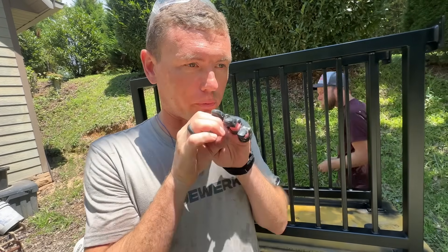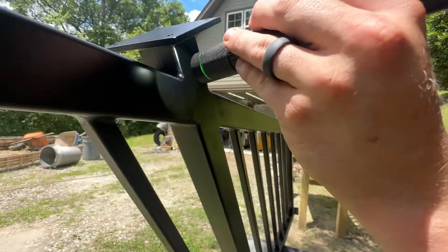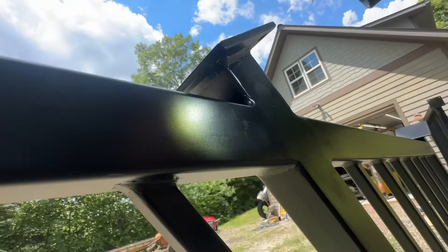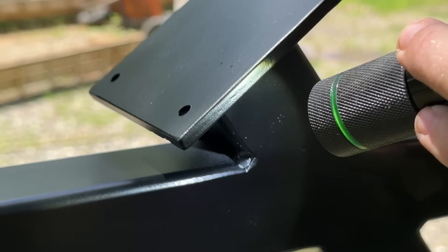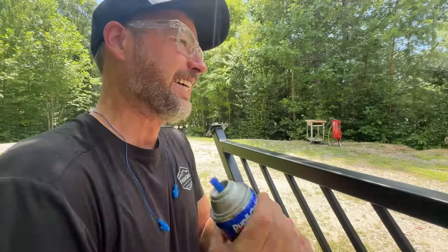Something worth highlighting: I only buy spray cans that have a fan nozzle, and it's usually rotatable for vertical or horizontal use. The ones that just spray in a circle or a cone — no way. The black satin I used to buy a lot, they switched it, so now I have to find a different one. We couldn't quite get up in there with the can, so you may just have to hose it in — I don't want to be the guy that causes a run.